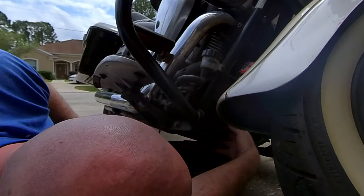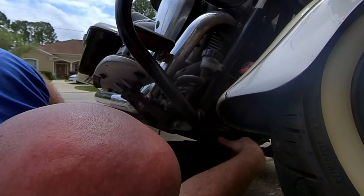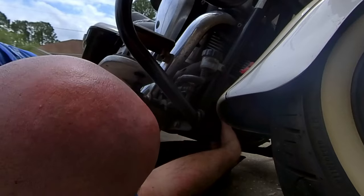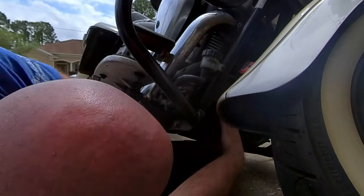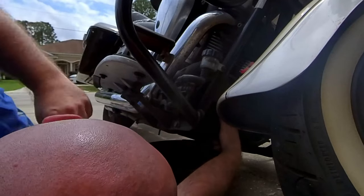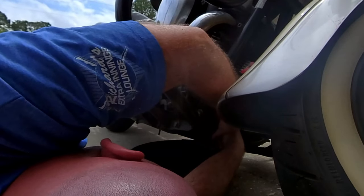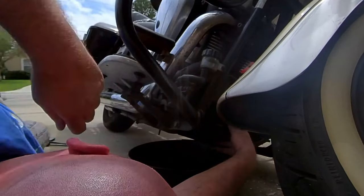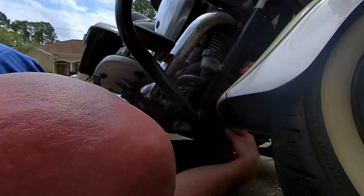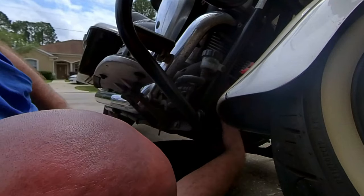Filter on until it touches, and then you make note of the starting point. I'm using these numbers right here, and you want 3/4 of a turn to a full turn, and that's as far on as tight as you need to get. If you put them on too tight, you risk crushing that gasket and causing a leak, and you don't want that,